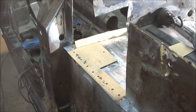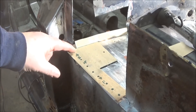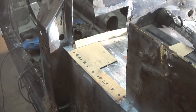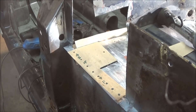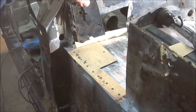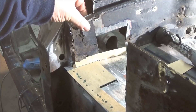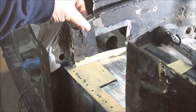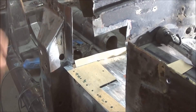We'll make that out of metal and just tack it in place a couple of places. We've got holes to drill for the spot welds along this flange, but we're not going to do anything serious until we fit a bunch of other panels. We need to get this patch sitting in there so we can start making the other stuff that goes back in. It's a bit of a puzzle, but we'll use this first patch as a good foundation to build up from.